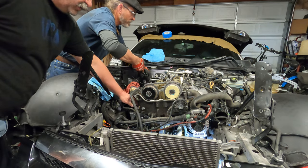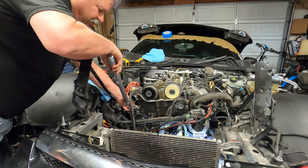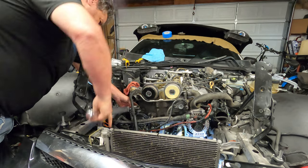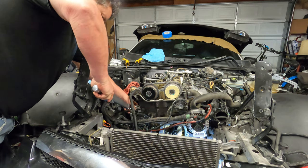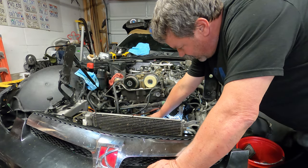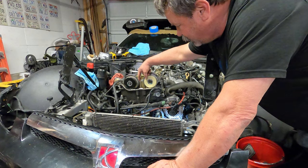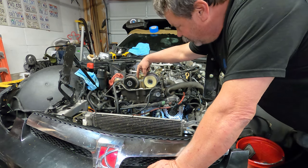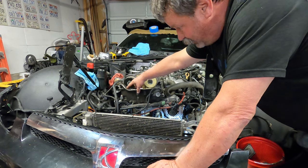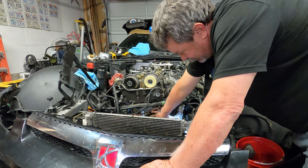All right, we've reinstalled the tensioner here, and it needs to be torqued to 55 foot-pounds. Click! Use the pulley to move the slack in the chain over to the right side of the engine. Now we're supposed to take a pry bar, push down in here, and pushing down in there is somehow going to activate the tensioner. Although, it's all pretty tight.